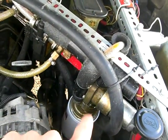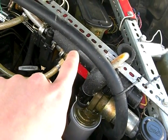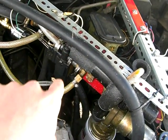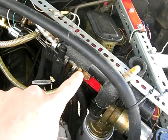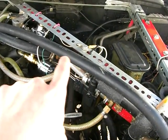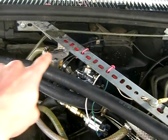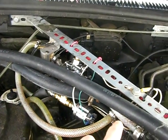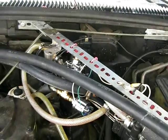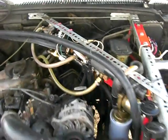From the tank it runs through my filter setup. Under there is a glow plug heater thermometer. There's my valve to switch. Here's my diesel line coming in, and then out from there there's my fuel pressure regulator, goes down to the fuel pressure sensor and back. There's the valve for my return line that sends it either through here to the return line back to the tank, or down back there into the regular diesel tank.